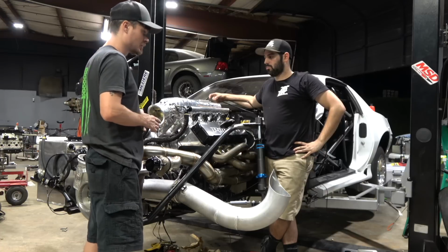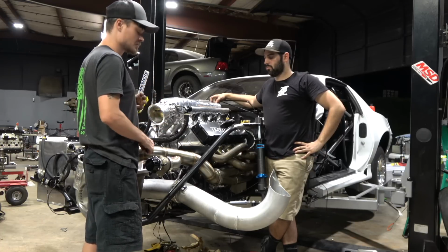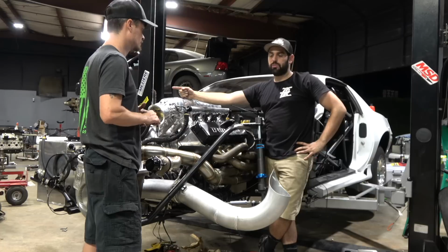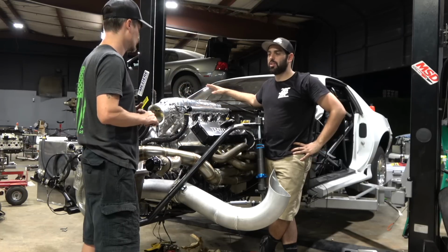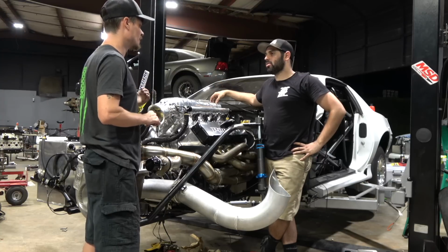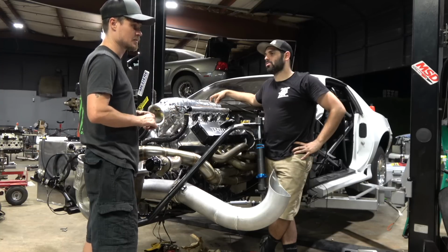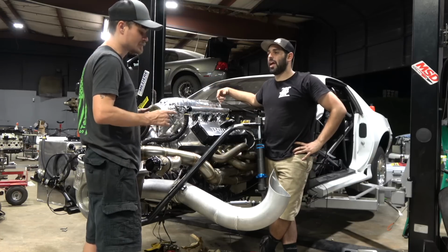Like I said, we went over all our lines, cleaned the fuel tank out real well, made sure there's nothing in the rails. For the record, our fuel tank right there, it looks kind of rough. We actually had bad gas. The welder seems to be doing better. We had some welding issues. I had to weld a bung on the transmission pan, and about three-quarters of that welded fine, and then the welder just stopped welding on AC, and I had to turn it off and on. So the welder is messed up, but we think we did have bad gas, potentially bad gas too.